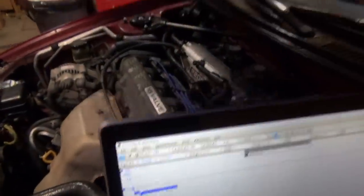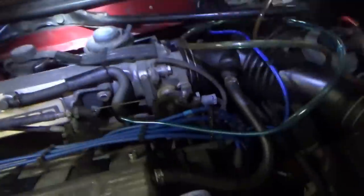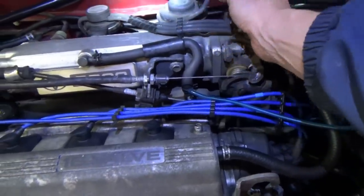Any time the vacuum is below that, that EGR valve is fully open. That's way too much. That means that modulated vacuum — it's trying to keep it somewhere in that range — that's the whole point of the modulator. In more modern cars with EGR valves, you have a potentiometer and a stepper motor driving it — it's a lot more precise. But in this case, this thing is so easy to open. Any time it sees the vacuum modulator starting to give it vacuum, it's like — pop, open. You get the surging. There's too much EGR flow. And then it shuts off and you get much nicer power. The fix here is basically to leave this line off — you can cap it off, pinch it off — whatever you've got to do to make this thing stay closed. Drivability will be drastically improved. No parts required. It's an old car.